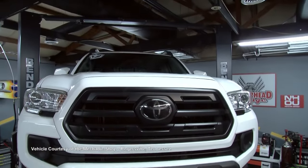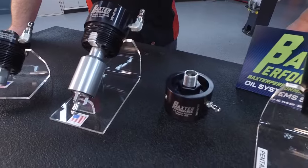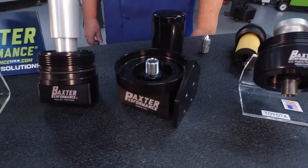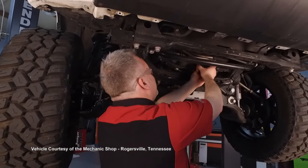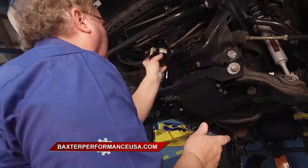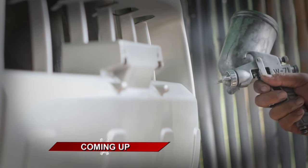For about 15 years Toyota's been moving away from the spin-on filter to a cartridge filter, and that creates a lot of problems. They're actually transitioning back to spin-on filters now — they were having drain-back issues and some people simply didn't like dealing with the cartridge filter system. It's no surprise they're going back to the reliable spin-on filter that incorporates an anti-drain back valve. The Toyota behind us has a Baxter Performance adapter installed — the installation is super simple, it was plug and play. All you do is remove the cap and filter, apply lubrication to the O-rings that come pre-installed, install it right where the cap was, and now you can apply your spin-on filter. This is American ingenuity made right here in America, solving a huge problem — you can find it at BaxterPerformanceUSA.com.